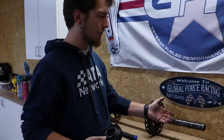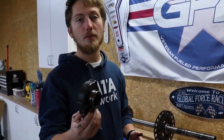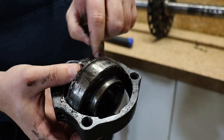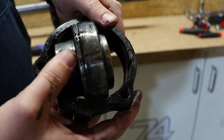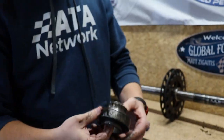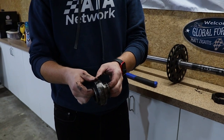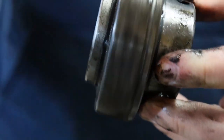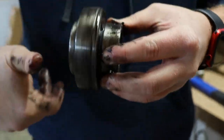So we finally got the bearing off here. I know that was a little unorthodox — we want to be a little more gentle when trying to remove a bearing. We knew we'd probably replace these anyway, but we're going to examine it real quick. Typically when you replace a bearing, you also want to replace the bearing cassette, which is the metal piece the bearing sits into. You can see these little channels right here where you can take the bearing in and out of the cassette. We're going to slide it out, pull the bearing out. As I mentioned earlier in the series, you'll be able to feel any crunching or if it doesn't roll smoothly — but I don't feel anything, I don't hear anything. When we spin it, it still feels like a really good bearing. We may actually end up cleaning this one and keeping it as a spare, but definitely no bearing issues on this side.